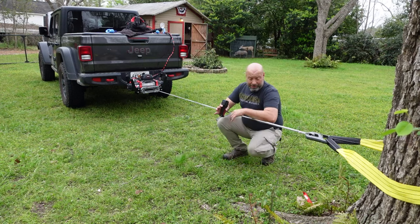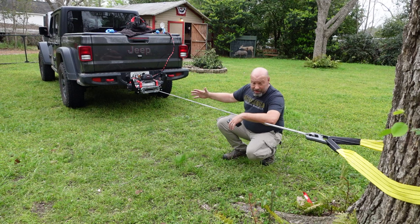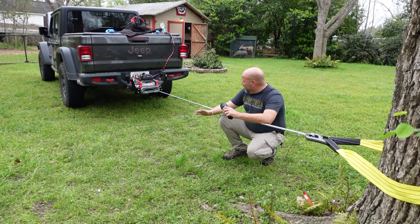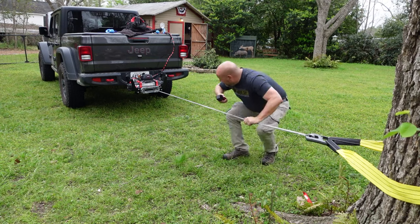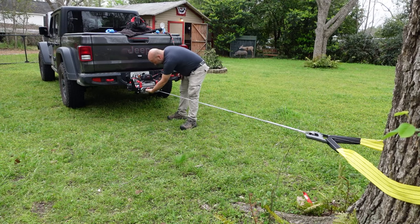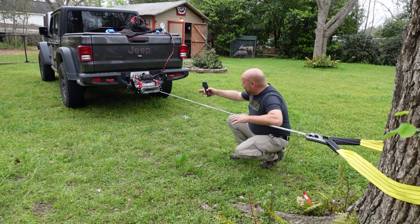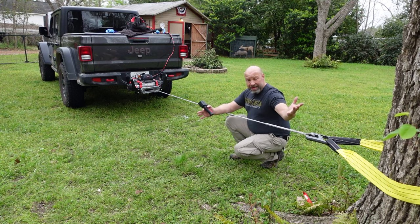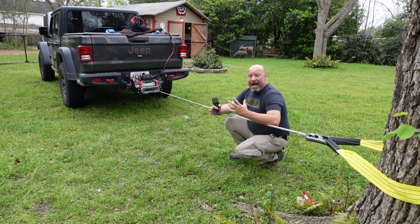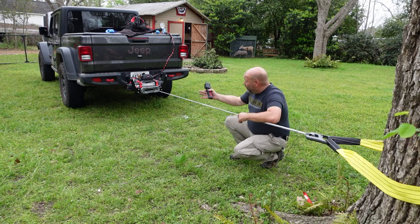The reason I can be here right now is there's very little load — probably just a few hundred pounds. We need to guide the line by hand to make sure the spool loops are perfect. There are no fingers or automatic guide to move back and forth — the only way to get it to spool up right is to do this by hand. Do this after your recovery is done, or at home where you can also wash the line if it's covered in mud.